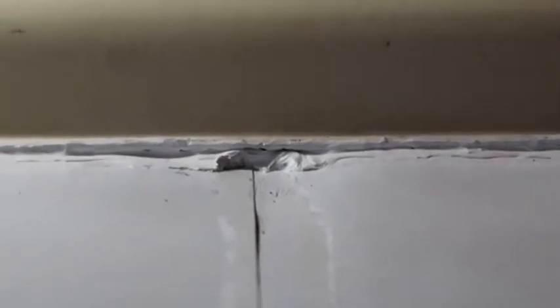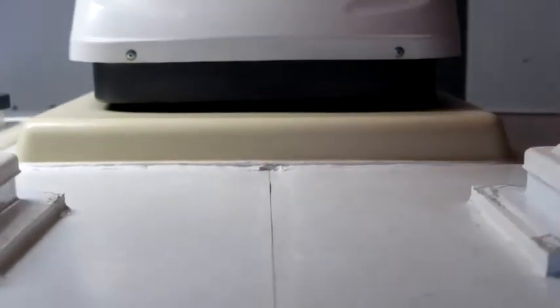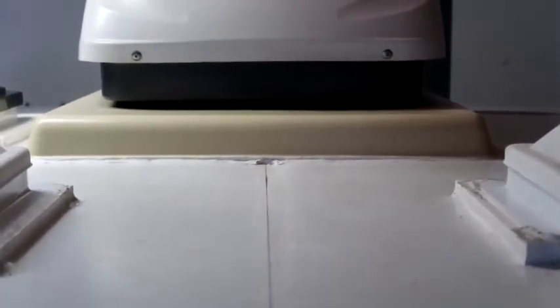That's some lap sealant right there that I stripped entirely away and put new stuff back on it. It's hard to see from here. You'll see where it's kind of coming apart there at the seam. It's actually dented up underneath there and I had to put a lot of lap sealant there, and it's kind of separating again — I just push it up there, I need to put some more in there. Underneath that little AC shroud is a pretty big separation between the AC unit and the gasket underneath there. That's kind of a concern, but I don't know how it got dented up in there.